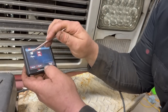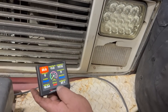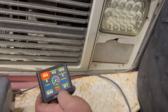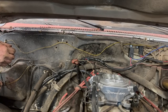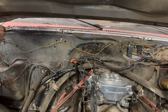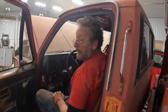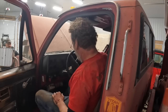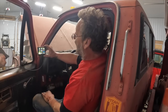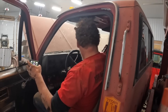In the meantime, Eric's going to have multiple gauges to tell him what's all going on with the engine — it's customizable. Last wire to hook up — a lot of them are temporary right now, but the last wire to hook up is the tach signal wire, and then we can fire it up. Ready? Yep. Listen to that, guys. We got our RPMs. It's running!